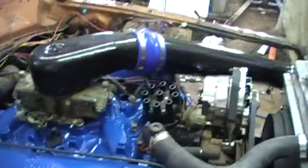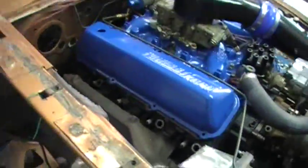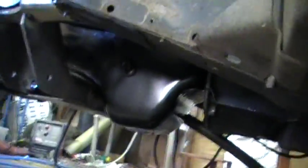Most of my lines are in — there's the feed line for the turbo, most of my vacuum lines, and the electrical stuff's done. I've got a driveshaft in it now — it's a Jeep Cherokee unit, 40 inches long. I used my old crossmember, just modified it a little bit. There's a better picture of my oil pan right there.